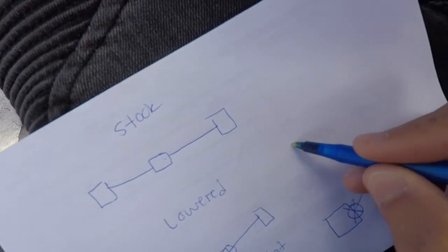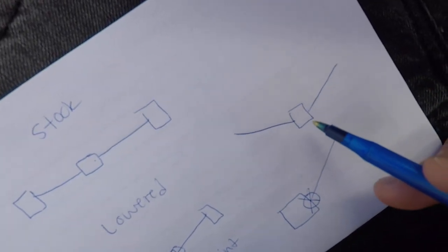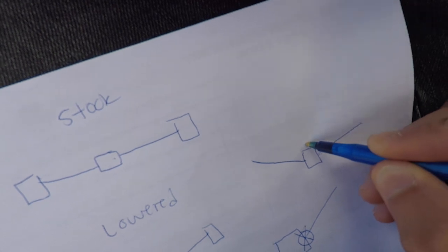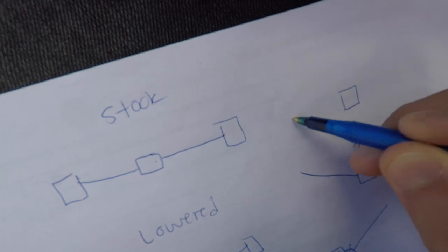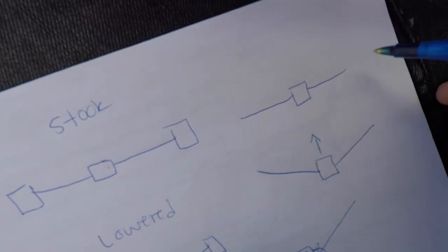So when we end up getting both parts that I need — this is my car lowered, the differential right here, the axle angle. With the diff riser that I'm going to get, it'll raise the diff up so the axle angle would be straight, just like stock. It'll take a lot of stress off the CV joints and axles. PBM said it'll come in about a month, but today I'm going to pick up the subframe risers.